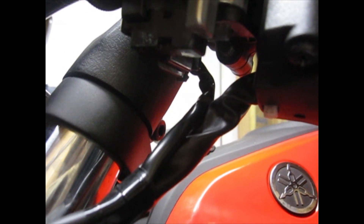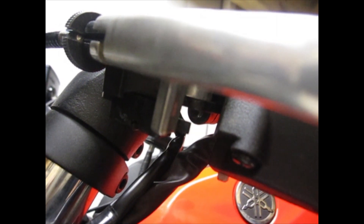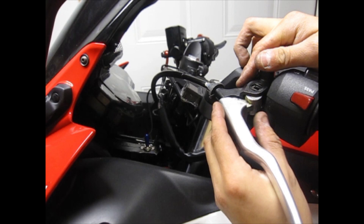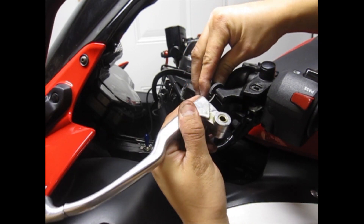Once you take the bolt out, you're going to want to pop the bolt out — just push it up and take it out. You're going to notice that the lever probably just popped out. You also want to be careful because there is a lever here with a little push button. Be careful with this because if you break it you're going to have to buy a whole new setup. Make sure you're careful with this little lever because it's plastic and kind of easily breakable. Once you take the screw out, take this part out and then just pull on the cable and take it out through the slots. Make sure that all the slots are lined up.